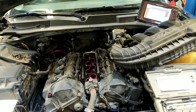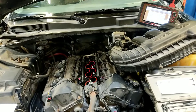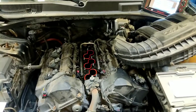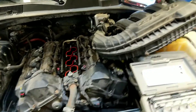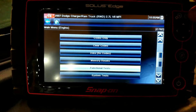We could have gone in and checked the spark plugs, verified that they were replaced, and checked the ignition coil, but to do that for bank one we would have had to remove the intake because it covers the ignition coils and spark plugs. As well as doing a compression test, we would have had to remove the intake to do that. So instead we went into the scan tool and we're going to troubleshoot the injectors.